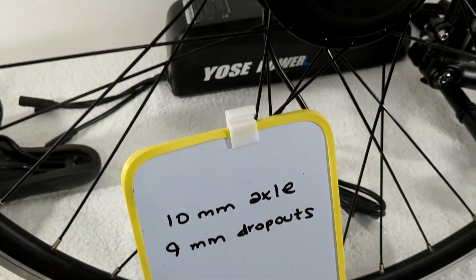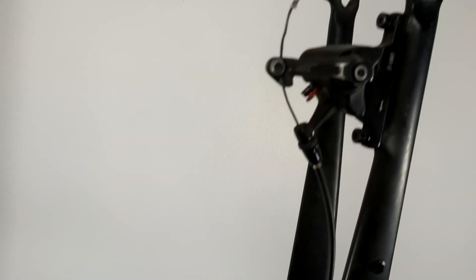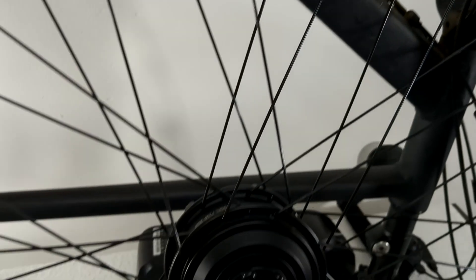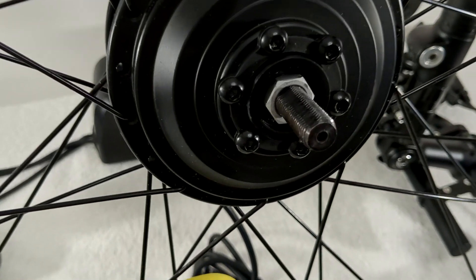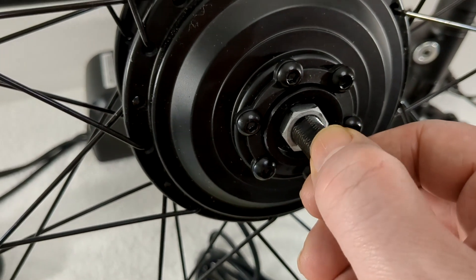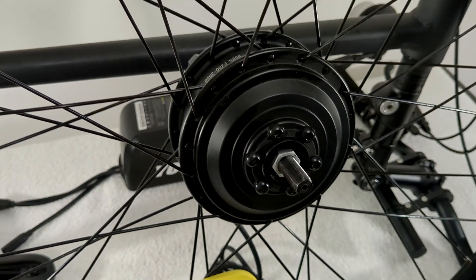So there's a 1mm mismatch — this is too big and that's too small. You take your chances on whichever one you want to file. I saw on the Switchbike video they filed the flat bit on both sides, and I think they've sorted out their problem. You'd need to ask them if you don't know.